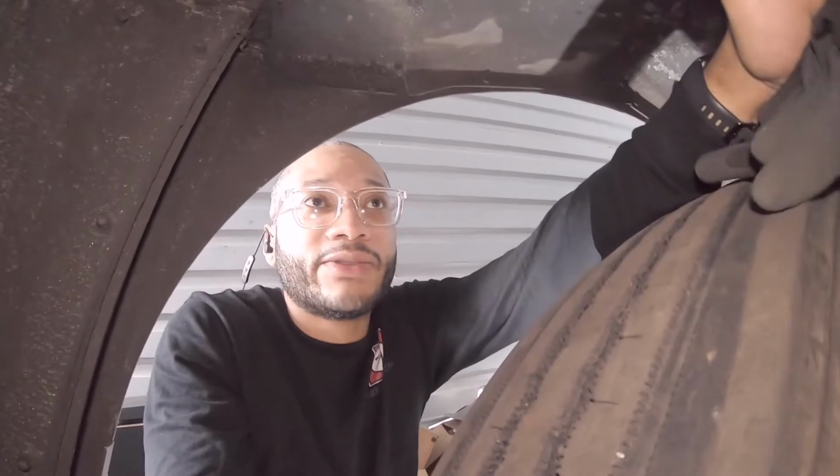I can rebuild the CP3 pump for the fuel, because that runs off of the rear gear train. That, and also the power steering pump is off of that. So I can rebuild those if need be, or replace them. I didn't touch those. We're going to see if they're leaking, how bad they're leaking, and we'll deal with that at a later date.